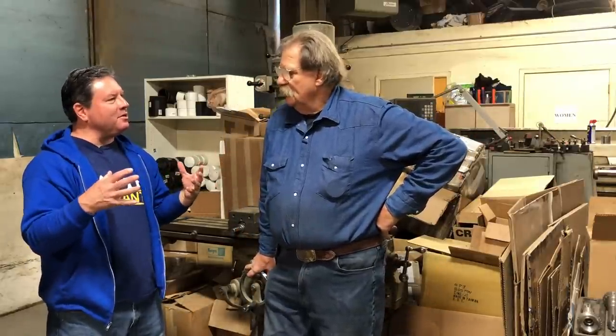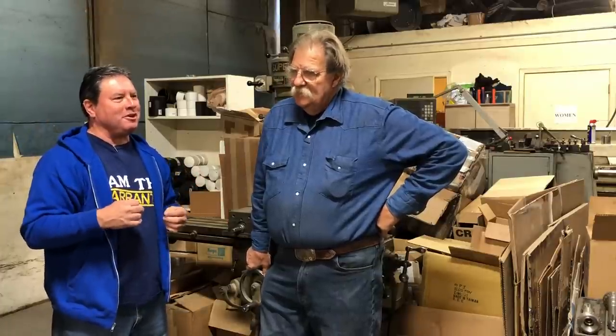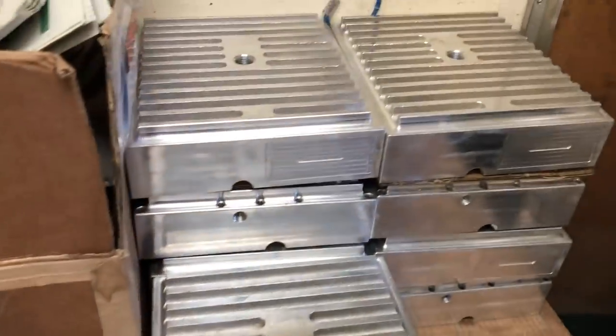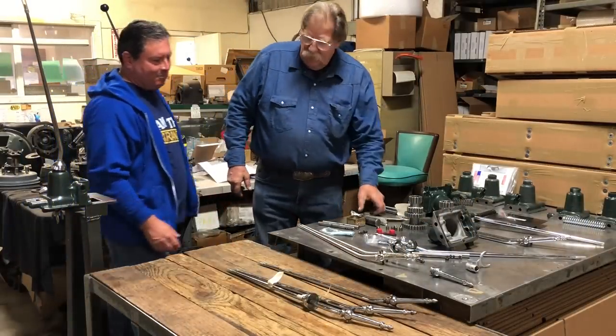After 21 years I'm still excited about the synchronized transmission — it's a game changer for people these days who aren't growing up learning how to drive a manual. People talk about needing to get younger people involved in Model A, and this kind of helps. If the non-synchronized transmission is what keeps them out of a Model A, then they should just get a synchronized transmission and come out and tour with us. If you get the 15% higher second but stock first and reverse, it moves the shift position much closer.